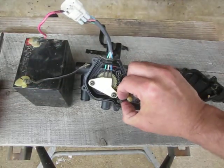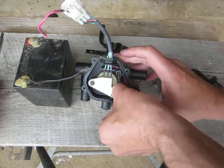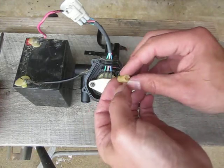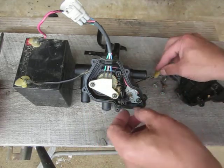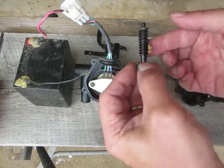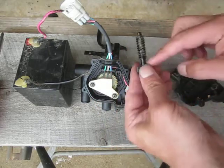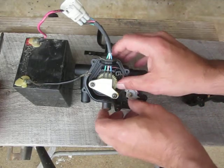So, before when I tried this, I didn't hear any movement, but now that I got the thing taken apart, let's take this out. Here's your drive piece. So potentially this could break, these threads could get stripped out. Okay, we got some grease on here. That all seems fine, no stripped out threads, nothing broken. The shaft could break. These pieces on the end could break. We know the motor turns.